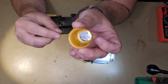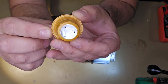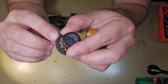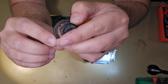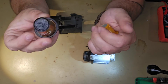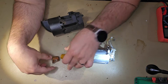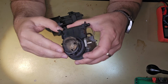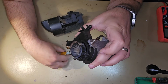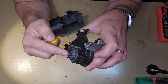of the capsule. As you can see here, there is a ridge, and it's only plastic, and on the original one, you can see it has a small silicone gasket on it. And this gives an advantage to the original Nespresso machine because also here, this part of the brewing mechanism is specifically done like so. If you use alternative capsules without this silicone gasket, it will drip.